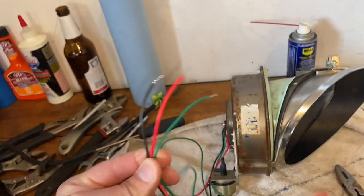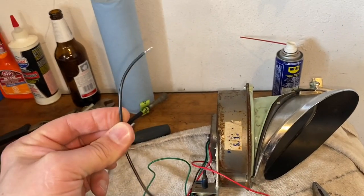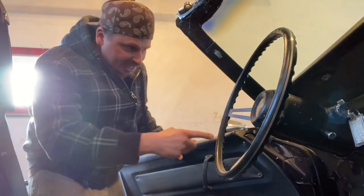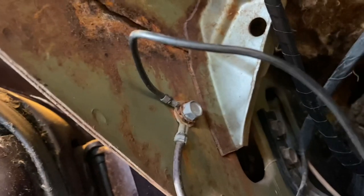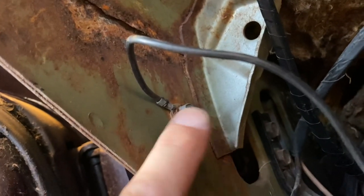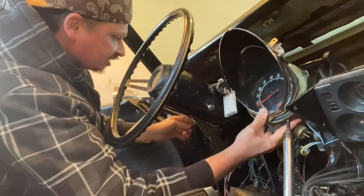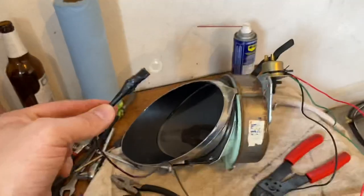There are only three wires so hooking up one of these is super easy. The first wire is your negative ground wire - you need to find a good solid ground inside the car. Right underneath the steering wheel is a perfect place. There's already a ground there for some other stuff. We're going to take those off, clean to bare metal, make sure those grounds are good, then add the new ground. Shorten the black wire a little bit and put a connector on it.